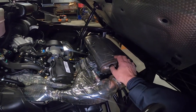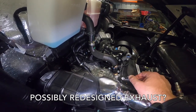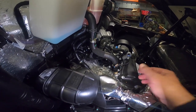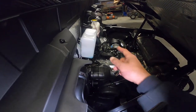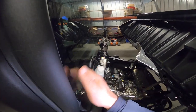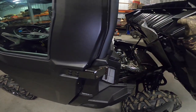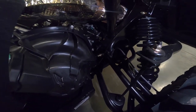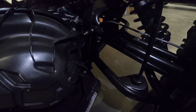I love this big engine — it's almost a Harley engine. This V-twin 1000cc engine is just a torque master. Mine is 72 horsepower; this is 82 horsepower. It looks like you have your coolant up here and your windshield washer reservoir back here. I believe the back panel is glass, not plexiglass. See the beefy hinge points on the machine. Can-Am and Polaris have really focused on heavy-duty suspension components — I don't know how you would bend these on the trail.